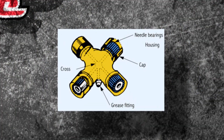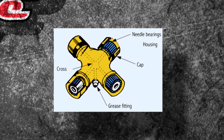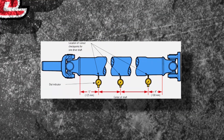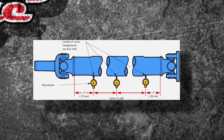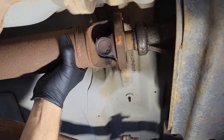With that comes some problems. They have to be greased and lubricated. You can see the little needle bearings in there. A couple things you can do with the drive shaft: you can check it for vibration. You can see here with the dial indicator and check it, make sure that it's all good and not vibrating. That's what we did right here — just grab it, go under there, make sure it's safe.